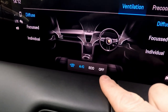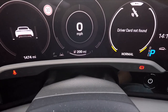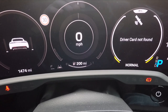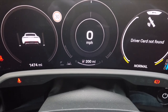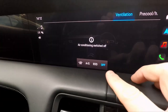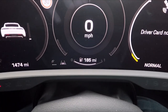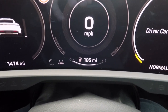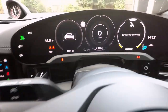I'm just going to turn this off again for you and go over to the range here. You'll see we've got a range there of 200 miles on the clock — we're about 75% state of charge. And if I go over to the air conditioning and turn it on, you'll see that my range has instantly gone down to 185 miles. It's taken 15 miles off the range there, so it's pretty significant — it is quite a hit on the range.